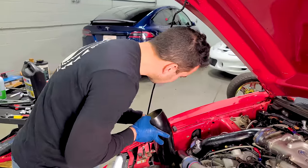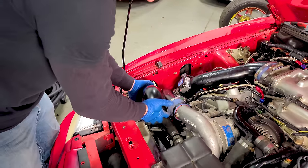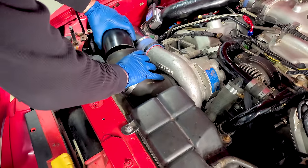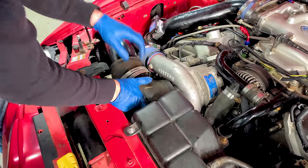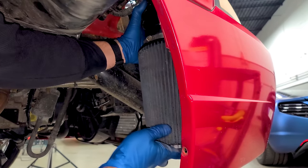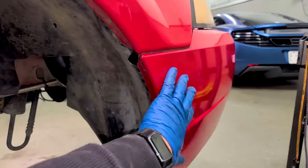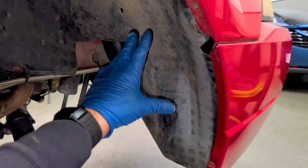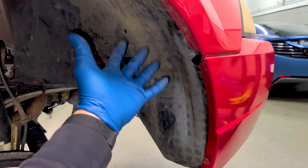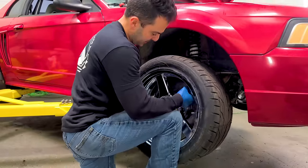Last up is the freshly painted intake — this is the one that gets the air filter in the fender. It goes in like this and twists down, then gets an elbow piece right to the blower. No restrictions whatsoever on this intake — it's a pretty nice system. Our freshly cleaned air filter sits in place. The air filter is protected by the front bumper and inner fender liner, which is a very important part of the car since the filter is right here — without it you could suck up water and hydro lock. The last chrome Cobra wheel is going on.